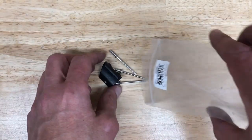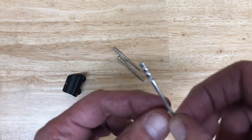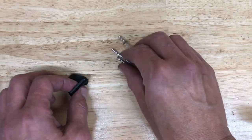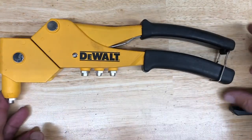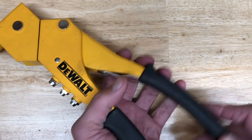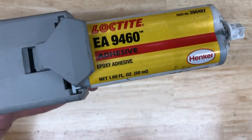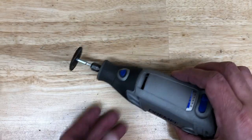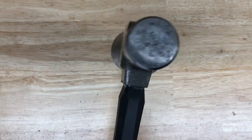This is the replacement kit that the customer ordered — little stainless steel rivets, pretty strong setup. The tools I used were my little Dewalt rivet gun with different sizes to match the rivet shaft size, some two-part epoxy adhesive — there are several different brands but this is something you definitely want to use — and my little Dremel tool with a cutoff wheel, plus some thin punches and a hammer.